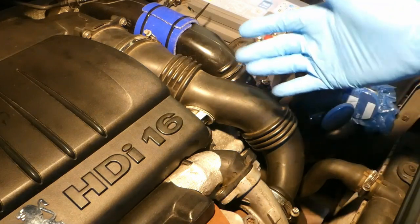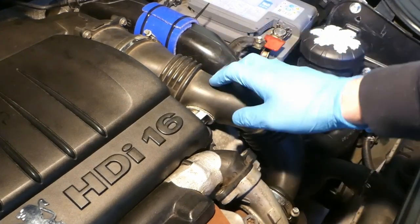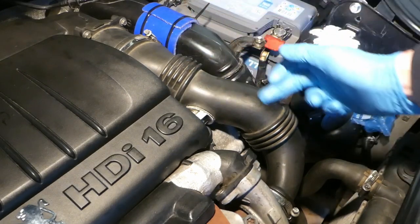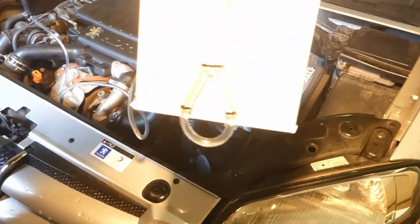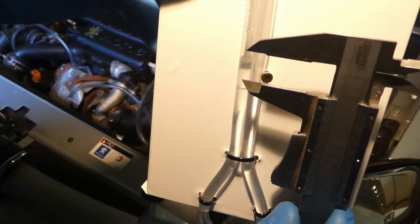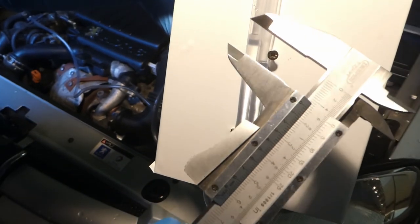Now to test the original design: I've put the original hose back so the air comes from the same place, so as not to affect anything. This is hooked up inside. I've left the catch can in but both sides are open so nothing really goes through it. Running the car with the original intake, the manometer shows the same reading — 1.4 centimeters, 14 millimeters. Absolutely no difference.